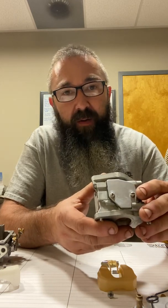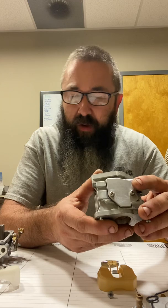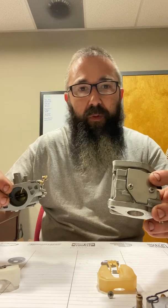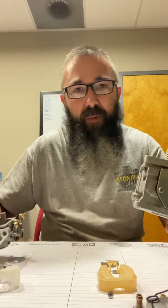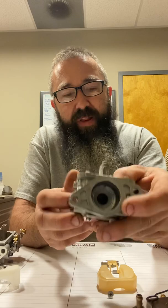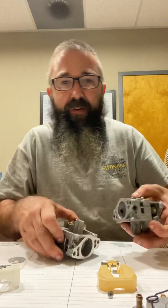I know a lot of you say you're not putting a 40-dollar Chinese carburetor on a two-thousand-dollar boat engine. For OEM versus a Chinese carb, the price range is a hundred to three hundred dollars for marine stuff. I'll roll the dice — if you get a bad one, you're out 20 to 40 dollars and you can return it. If you want to keep that OEM carb, you could bore that venturi out to 800 thousandths, since the butterflies are identical at 910 thousandths and the inlet surfaces are the same at 1.275 inches.